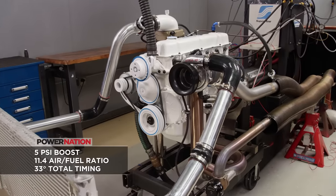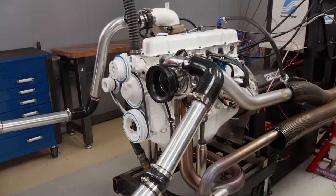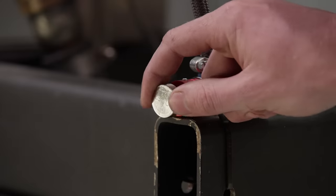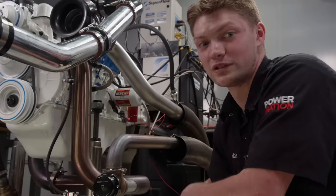That's a fun sound right there. The boost makes a real difference — 436 pound feet of torque and 345 horsepower at 5,000 RPM. We make a series of dyno runs, adding more boost each time. Eventually things get a little greedy. The boost controller is nearly at six PSI — we're running a really light spring. 'I think we need more boost, and I can't even believe I'm saying that. I feel like an invasion of the body snatchers — I'm a naturally aspirated guy. But I want to see this thing make some power.'